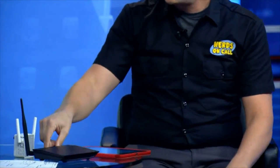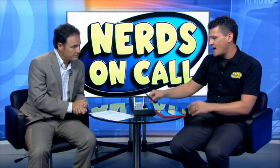There are 2 ways you can upgrade that signal. One is you can get a high gain antenna and put it on your router. Most routers have a little antenna on them that you can unscrew, and you can get a high gain antenna. It's a much bigger antenna, and that'll give you a lot more signal. How much? Usually under $50 to get a high range antenna. You can get them on Amazon.com.